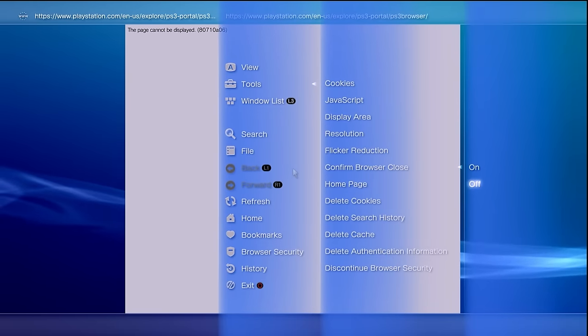The main things you're looking for are going to be the number of dangers and number of warnings. Ideally, we want both of these to be zero. If there are any dangers, do not continue on with this. If there are any warnings, look into them — but you really want zero and zero. One of the main warnings is typically ROS0 and ROS1 not matching. If you get any warnings or dangers, I recommend taking an official firmware update and reinstalling it on your PS3, then make a new flash memory dump and check it again. If you have any dangers or too many warnings, you risk bricking your console.